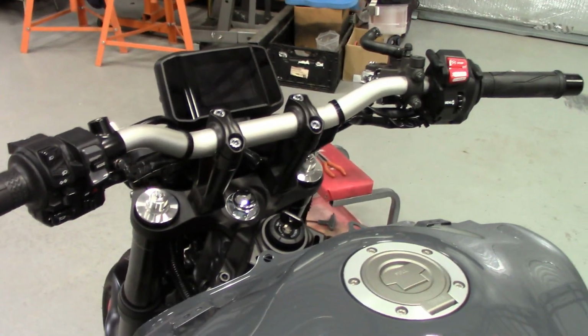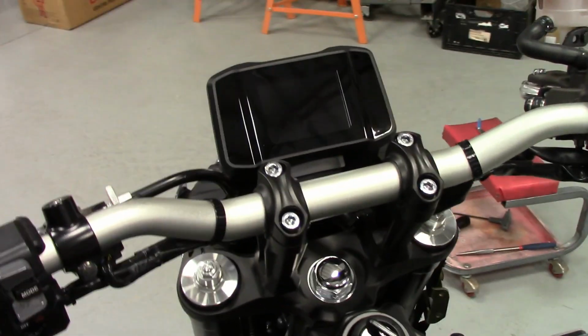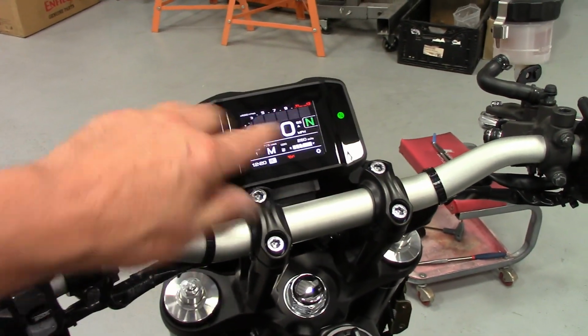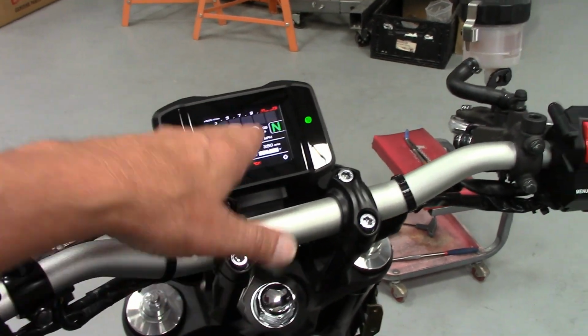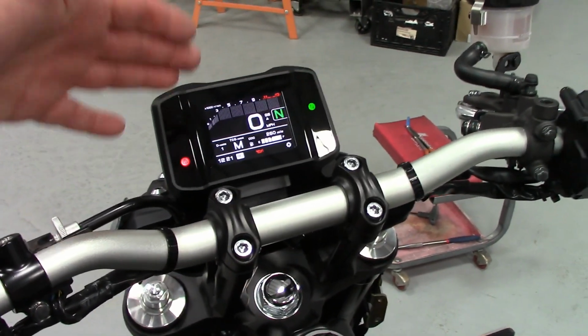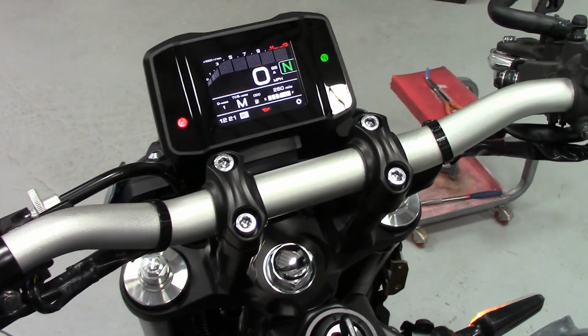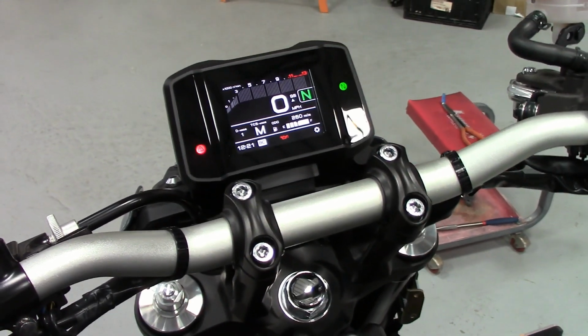Yeah, so the reason I did this now is because I want to turn off all the traction control and every restriction on the dyno. So now we should be able to start it up, because when the engine light's on, you can't change any mode, nothing. So on the dyno, I can't check the power and all the different modes without clearing the engine light each time. We'll probably do that another time just for fun, because I have to clear it each time.